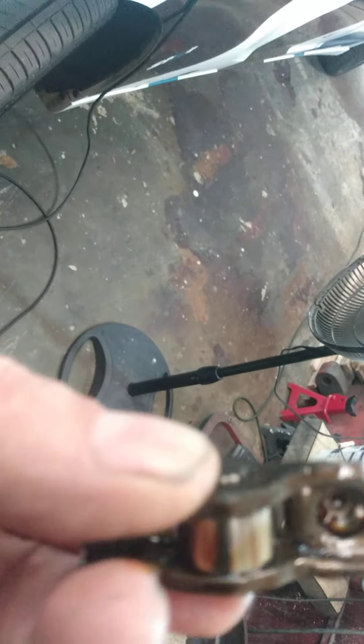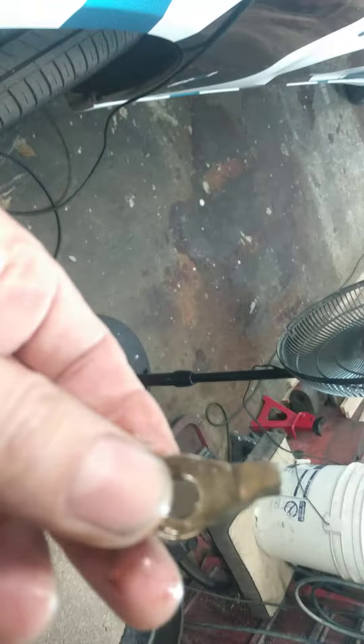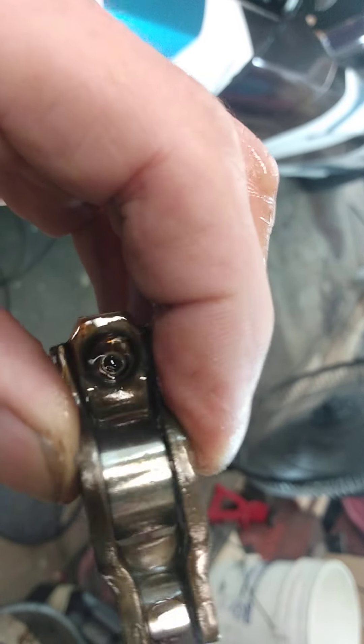Here's what goes on with the rockers. You see this pin? See how much that pin is actually moving? It shouldn't move at all. There's also needle bearings in there — if you don't change your oil on this thing, these will almost certainly lock up. One pin is tighter, but the others are all really loose. Compare the loose one: you can shake it and hear it rattle. That's because the pin is moving.